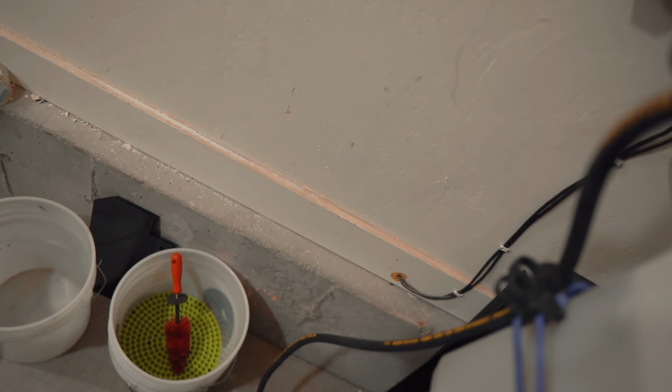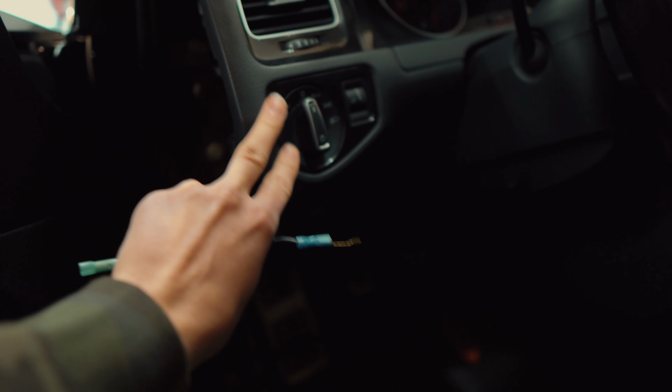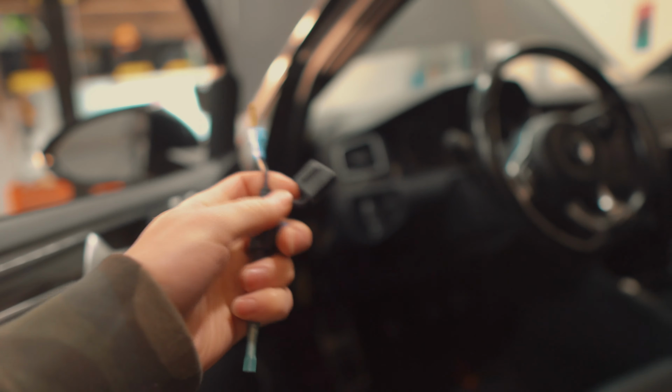So I'm going to connect the fuse wire up in the fuse box. It's on the driver's side, right underneath that little drawer tray. A little change drawer, you just pop that out, and then you can run your piggyback fuse, which is this little pink wire right here. So you'll just connect this to your piggyback, and the fuse box is right in here. You just go right below the light switch, and there's a little change drawer thing right there. We pop that out, there's a fuse box, and do a fuse that is only gonna turn on when the car is on, and that is what will tell the air suspension to turn on. So we'll get all that done right now.